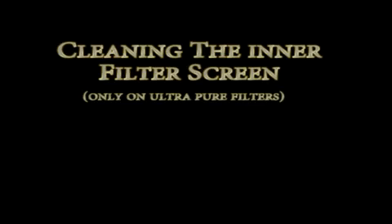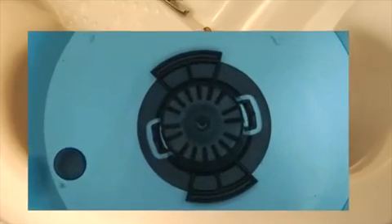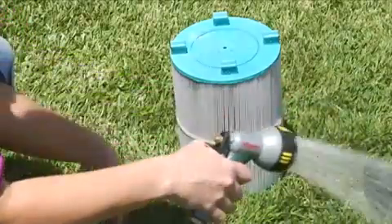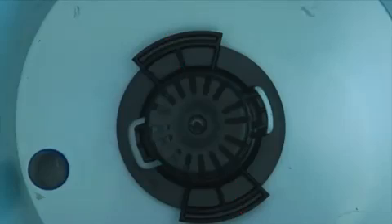It is also advised that you clean the inner filter screen. Once the filter has been removed, you should be able to see the filter screen located inside the black plastic housing. Insert a flathead screwdriver into the clip and pry it out from the housing — once one clip is loose, you should be able to remove the entire housing. Pull the inner filter screen out of the EasyLock housing and rinse with high-pressure water from both inside out and outside in. Place the inner filter screen back into the housing, making sure the grooves line up so that it fits completely. Reinstall the EasyLock filter screen by lining up the clips with the tabs at the base of the canister, applying firm pressure until the clips grab, and squeezing the EasyLock on the sides perpendicular to the holding tabs to lock it into place.